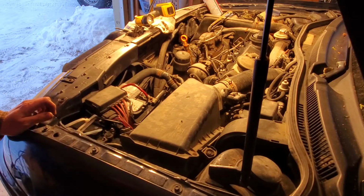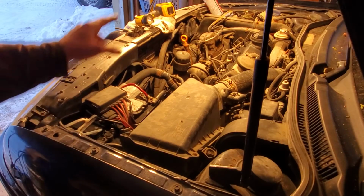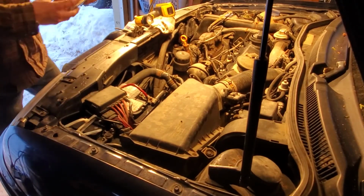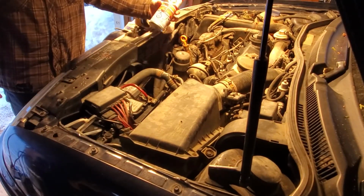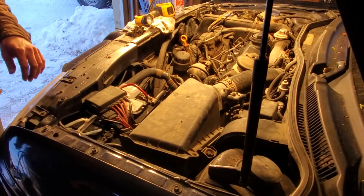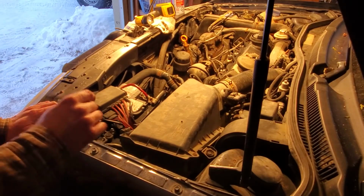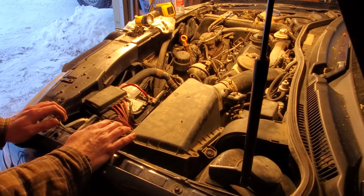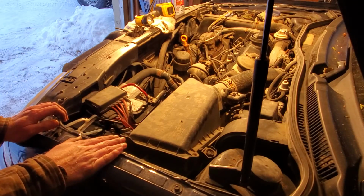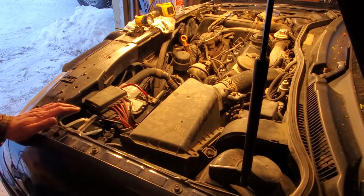So I gotta put the power steering line brackets back on underneath. I'm gonna put some fluid film on the line, the steel line that's coming around. The paint's starting to bubble off, so I want to protect the steel. It's already pretty rusted in a couple spots. I gotta put the driver's side splash shield for the engine bay on, and then get the belly pan on, and then I can get it down on the ground and roll it out for a test drive. So I'm gonna get to that.